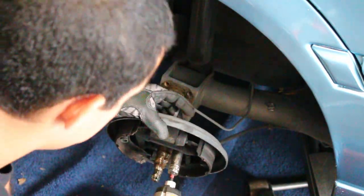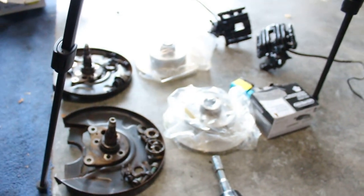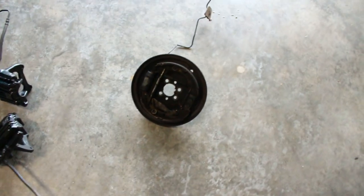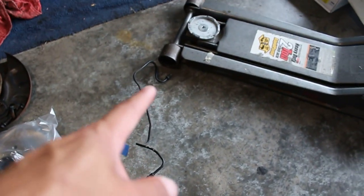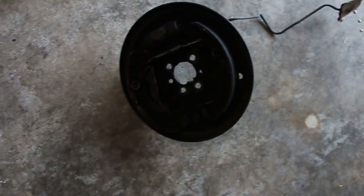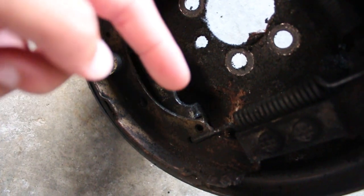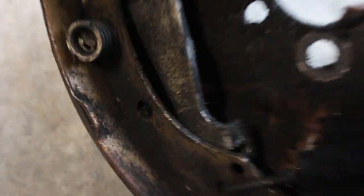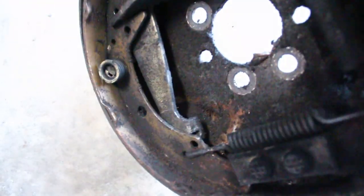And we're off. All that is left after you've pulled all of this off is to disconnect my brake line from over there and then disconnect my e-brake from the back here, and this whole entire thing can come off. Just like that, our first side is out. To get off your brake line at the first fitting, it's an 11 on this side and a 17 on the bigger side. The e-brake going into the drum is kind of a pain - get a flat head behind it and wedge it down through the little gap on the back. Just keep working on it and it should come out. Now we can start installing the new one.